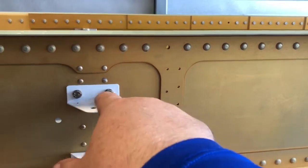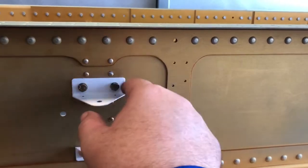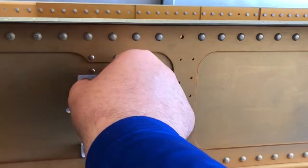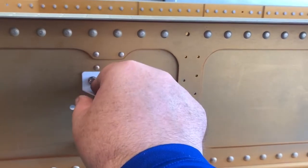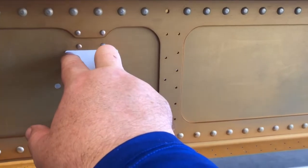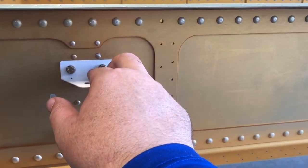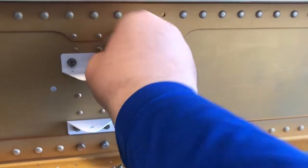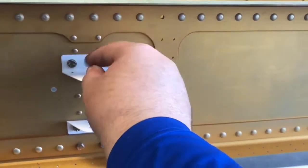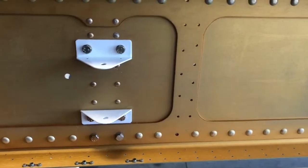To run the safety wire: put it here, wrap it around and twist it, then bring it around in the righty-tighty direction — you want it always pulling toward tightening. Whatever direction it goes to loosen, pull the safety wire the opposite way so it's always keeping the bolt tight. We'll get into the full safety wire procedure when we torque everything down.